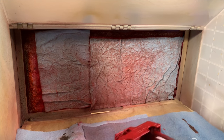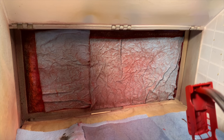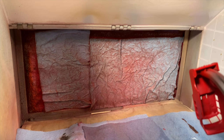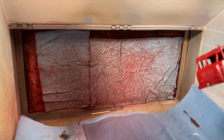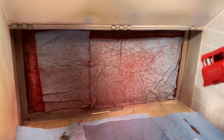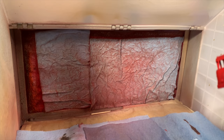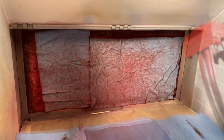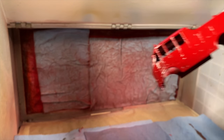As always, I'll start this paint job off with a nice thin tack coat. Then I'm going to follow it up with a medium coat, and then wrap everything up with one or two really nice wet coats. The trick with the wet coats is it has to be wet enough that it's glossy and shiny and wet looking as you're laying it down, but not so heavy that it's going to run or sag. The only way to get that is to have proper lighting so you can see the paint as you're laying it down. See how shiny this sucker is? That's what you're looking for — that's exactly how you want it to look.